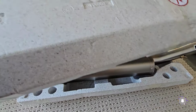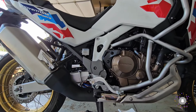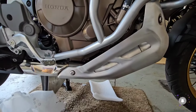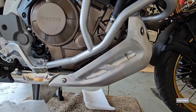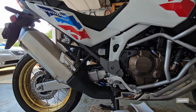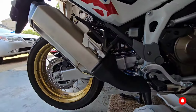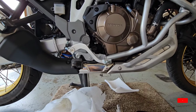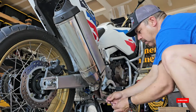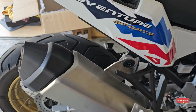So all right, we're going to cover it and move all these parts away from the bike. Basically I will do this fast, because what we need to do is remove that bolt, remove the ones from here, remove the engine cover, the lower engine cover, all the bolts, and then I will show you what is next. For the moment, this is not a lot of science, so I will remove this one, and remove the slip-on, and then I will take another picture to show you the before and after. Before I forget, I start removing things, but let me see how it sounds before and after.